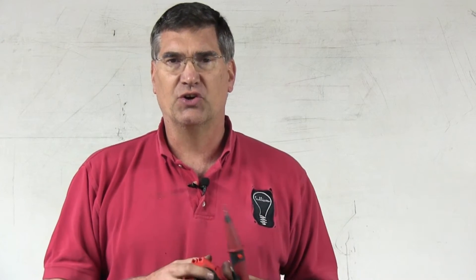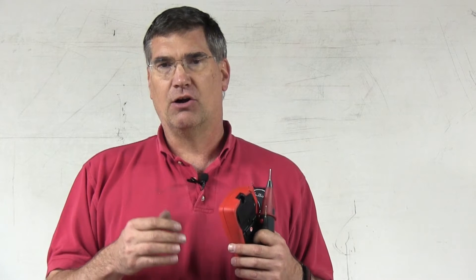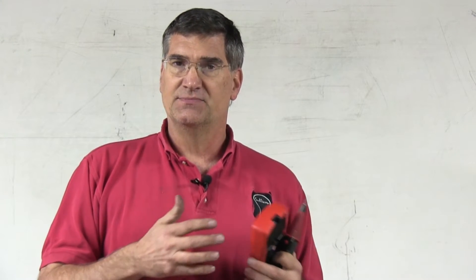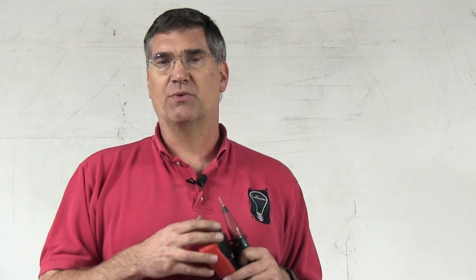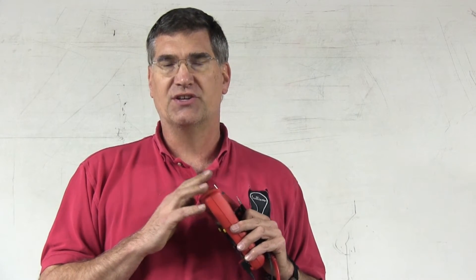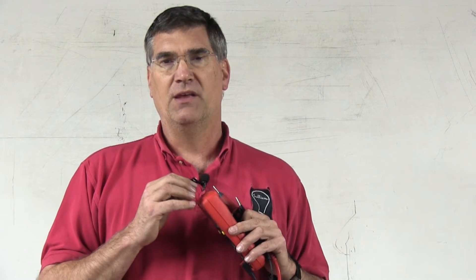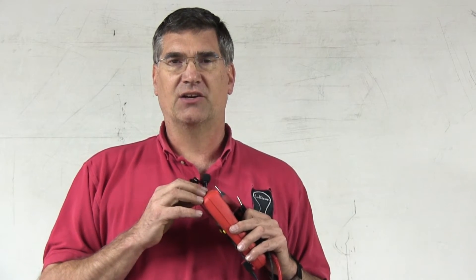The voltmeter is completely safe. It doesn't do anything — it doesn't turn the circuit on, and it has very high internal resistance. So when you're using the voltmeter, you can be very confident that you don't have to worry about where you put it in the circuit, because it isn't going to cause any major problems. The ohmmeter and the ampmeter are not the same. The ohmmeter can create problems if the circuit is not disconnected, and if you don't remember that you're turning things on with the ampmeter, somebody can get hurt. So it's important to know which meter you're using, how it works, and where you are in the circuit before you start testing. The voltmeter is the most important meter you use — it should be the meter you use first and the most. If you use it properly and understand ghost voltage, true zero, and voltage drops from the LoadPro, the voltmeter is going to prove to be an exceptionally good tool for diagnosing faults.